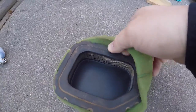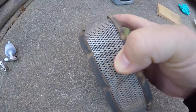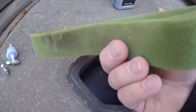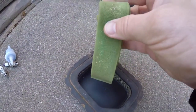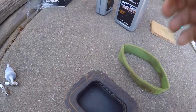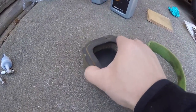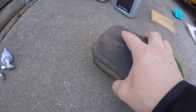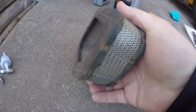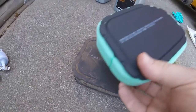This particular mower has a pre-filter, which is made of foam, and then the true filter is a paper filter protected by an aluminum screen. You can clean the pre-filter using soapy water — use a good detergent like Dawn dish soap, clean it, wring it out, and let it completely air dry. You should use motor oil, the same type that you use for your mower, to grease it back up and put it back on your paper filter. Your paper filter can simply be knocked on the ground to remove any debris or dirt that's built up. Don't use any pressurized air compressors to clean it out because it will damage the air filter, and don't get it wet. After the first year, maybe two years, you can replace it with a new one.